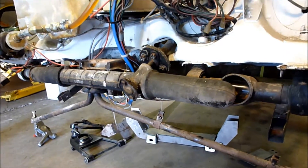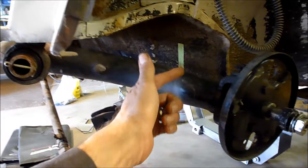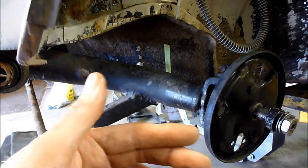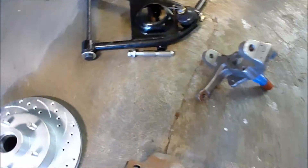I'm going to use the Subaru 360 steering rack and the Subaru 360 control arms, which I've taken the torsion bar out of — so they're actually individual control arms now. I didn't know you could even do that. I'm probably going to end up cutting them about here, bringing them out a little further, and then putting on some big brakes and some type of a ball joint arrangement.